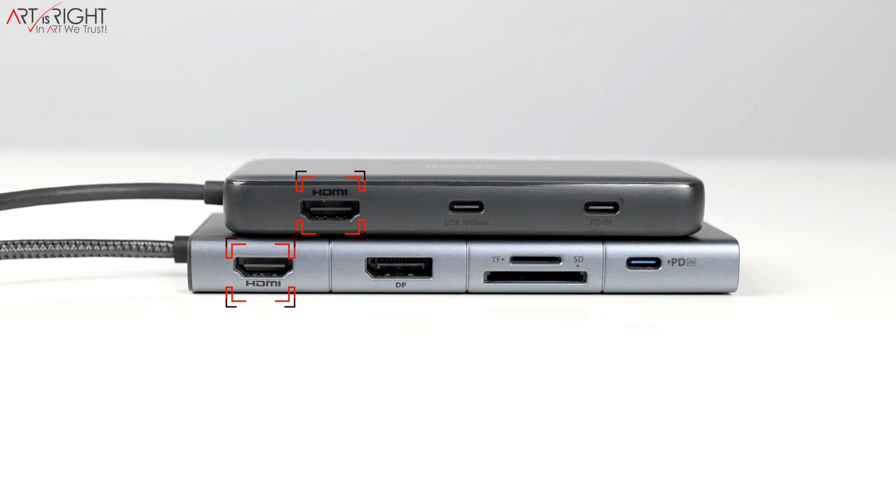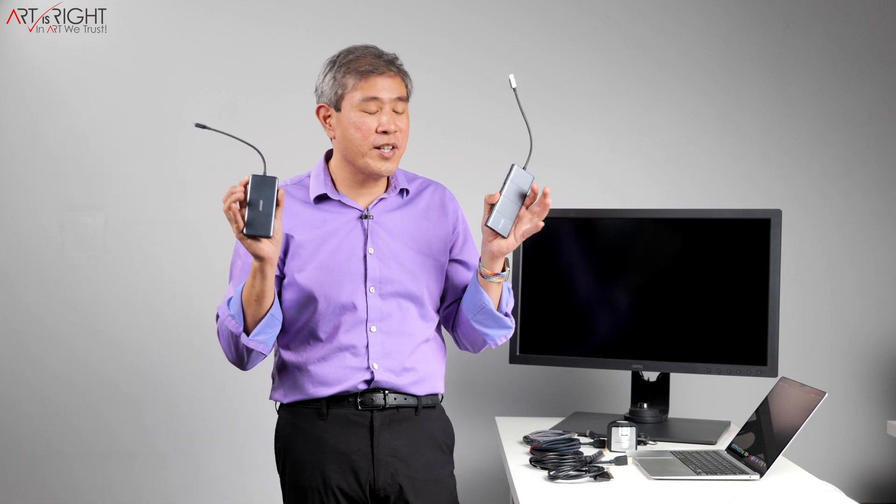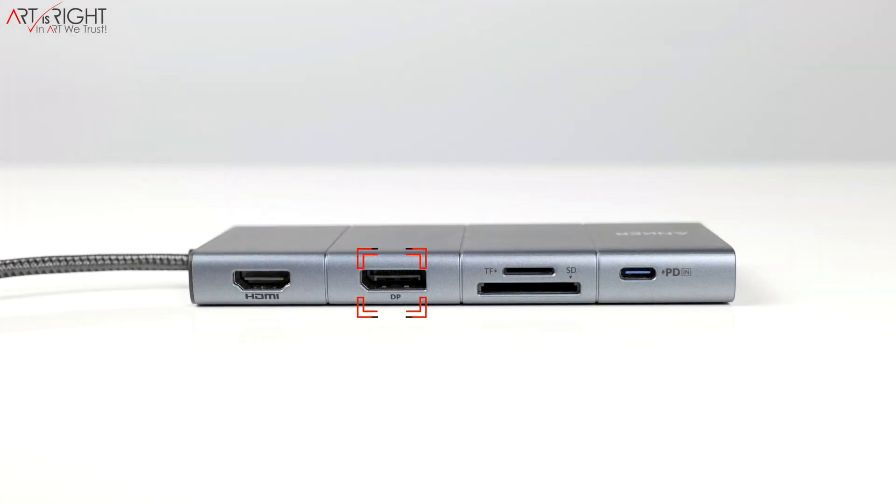On both hubs there are display signal outputs, and we're going to specifically focus on that. If there's any change to the display signal in the RGB range with a hardware calibrated display, you may get a validation failure. For this demo I'll be using the BenQ SW-271C. I've already tested off camera — HDMI on M1 computers, with or without the hub, works fine with hardware calibrated displays, outputting full range. But here I'm going to test the DisplayPort output.